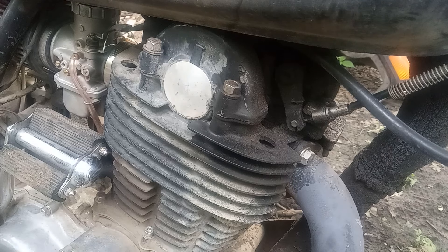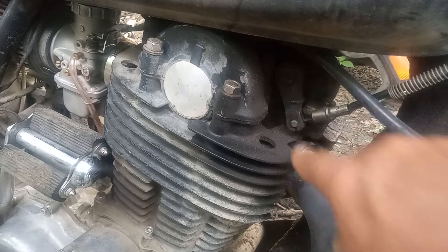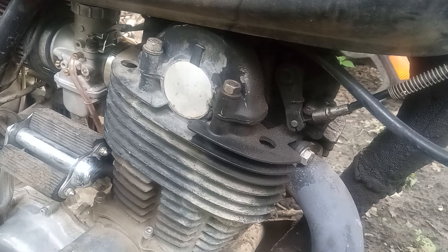Turns out it isn't electrical. I was going to pull that headlight out and look in there, but it seemed like an impossible thing. This little thing here is a decompressor, and there's a little cam that works on the rocker arm and slightly lifts the exhaust valve — that's how you get over top dead center to start it.